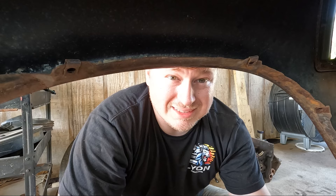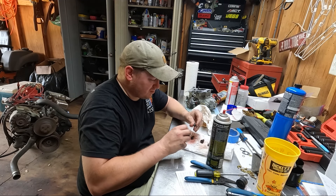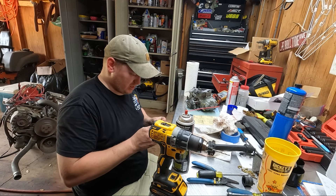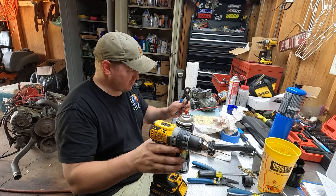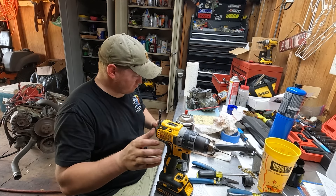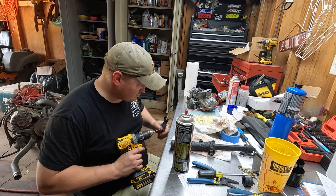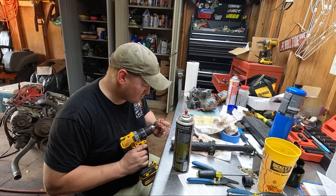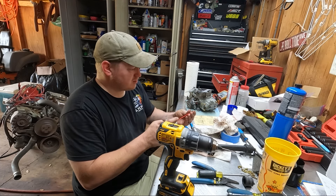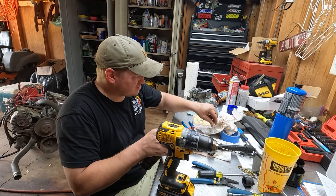Let's go check on our bleeders and then we'll have the front assembled and done. They've been soaking for a while but they're still pretty gummed up, so I'm gonna try to clean them up and shoot some juice in there. Here's what I'm doing - I've got a drill bit that is just under the size of the hole coming out of the back of the bleeder and I'm just drilling out all the rust. Until I can get new bleeders, this will work just fine. I'm just stopping right when I see the drill bit crest that hole - it works now, it was crammed full just a minute ago.